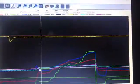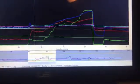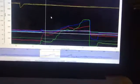All right, data log here. At this point right here, our fuel pressure is in purple, and it's at 61 psi. Our boost, we're going to use our MAP sensor, which is blue, and we are at 66 kPa. So basically at 66 kPa we're still in vacuum. So we're making 0 psi of boost right there. In fact, we are in vacuum.